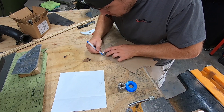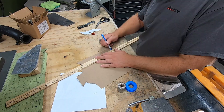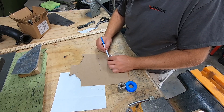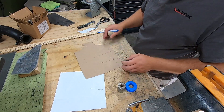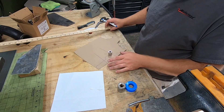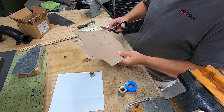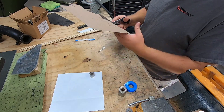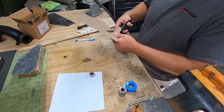I've got the unit hanging in place with some safety wire, and I started with a paper template. Now I'm refining that design a little bit on some cardboard to then transfer it to the stainless steel — the same steel I've used on random brackets like the intercooler mounts over on the other side. The goal is to isolate the radiator from the airframe, riding on high-temp rubber grommets. So I'll just shut my mouth and let you watch the process.